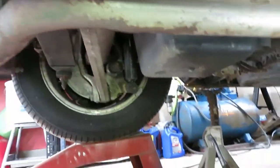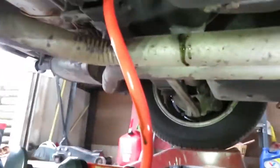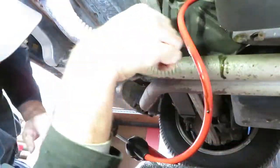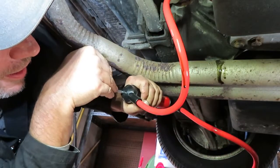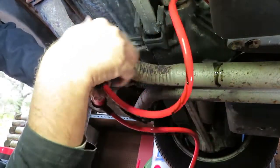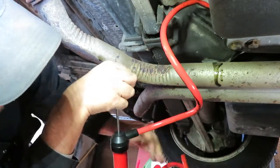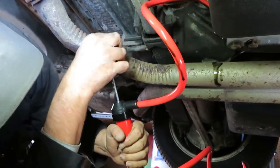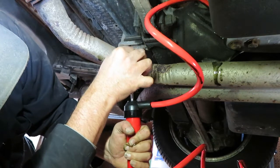We're back. The tube goes in like that and you just pump away. The fluid coming out smells pretty bad — like Taco Bell. This stuff is worn. Plenty of discoloration and I can see silver metal in the fluid.